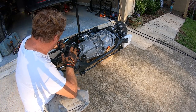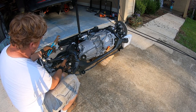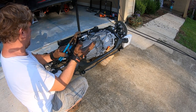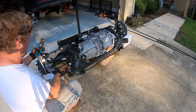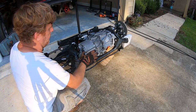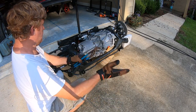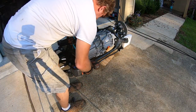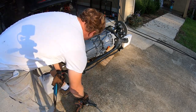Now to disassemble — to take the CV shaft out it almost looks like I'm gonna have to take the bar links off and remove the suspension to pull it. But if I remove the drive unit and rotate it up I should get enough slack to just disconnect the shaft that way. This is a lot of work — I'll try rotating first, and if I can get movement and pop those out I can sit the drive unit to the side and let those dangle, then drop the other one back in.